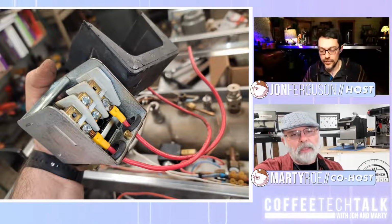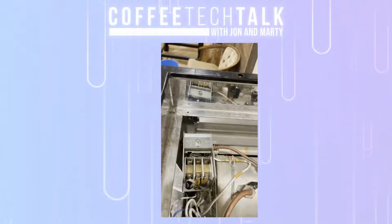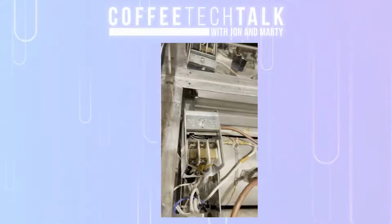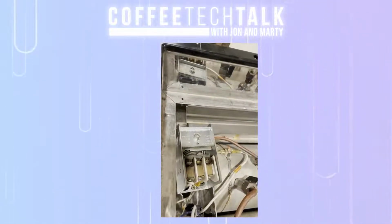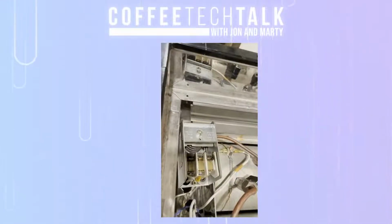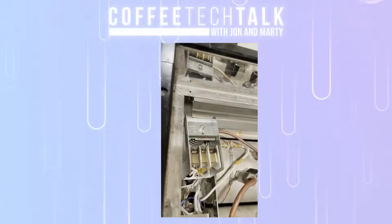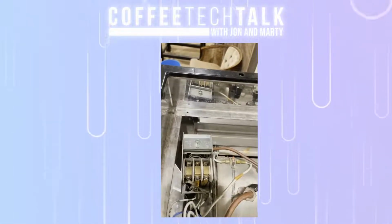Well, let's talk about that extra thing in the middle there. Dietrich, you want to show the final video that we have? Yeah, what you were able to do, John, is you've got 2 circuits on that pressure control, and a 3rd unused set of contacts. And so what you were able to do is move the wires off of the one that was arcing, not making good contact, and swing them over onto the unused one. And that actually is a pretty good fix for that circuit.